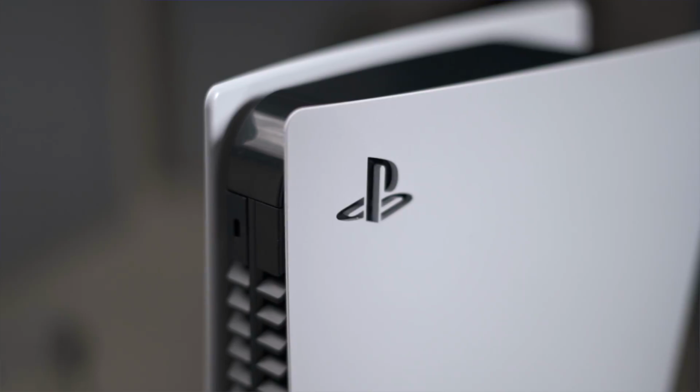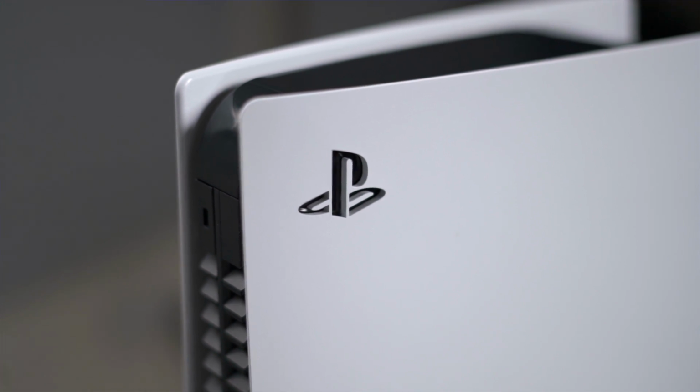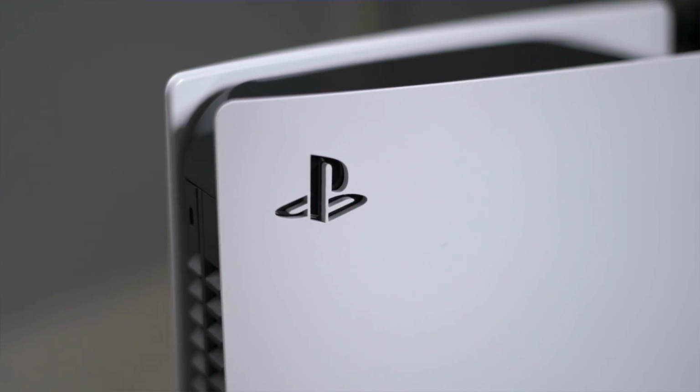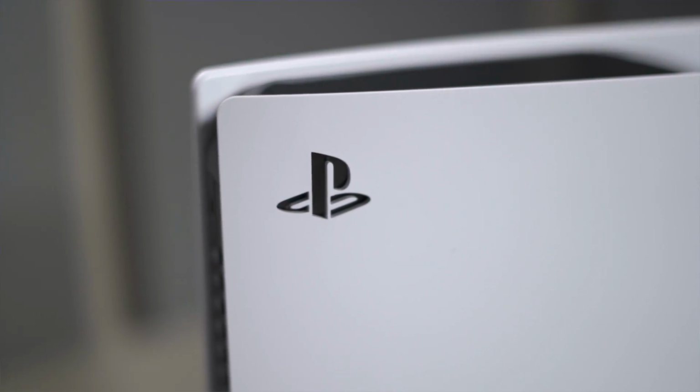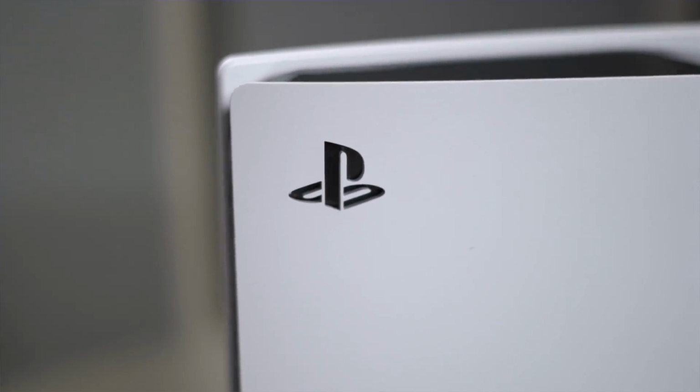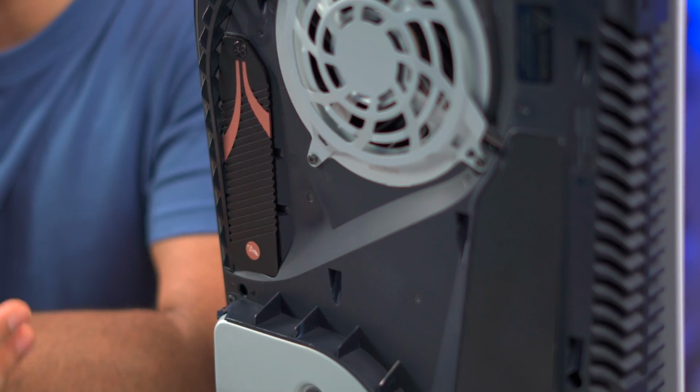Also, the PS5 is a mass consumer device. For some users, they are already nervous about taking off the lid and doing this upgrade, and we don't want users to go through the whole building a heatsink around the SSD with a whole bunch of these tiny little screws, and even with some heatsinks with elastic bands, which again is not a good way of mounting a heatsink, which I've seen on the market. So to combat the thermal issues and to make the installation process easier, after a few iterations and a lot of tweaking, we of course came up with this design, and it works great.